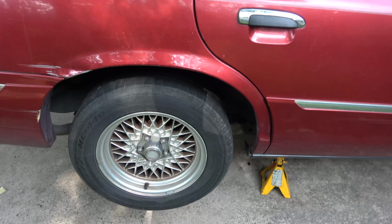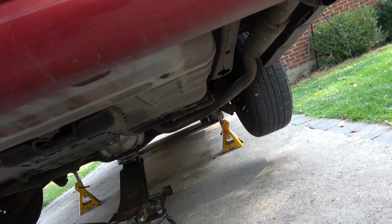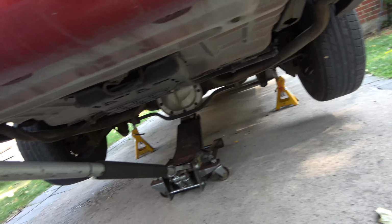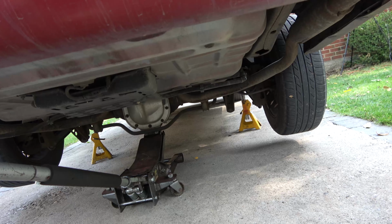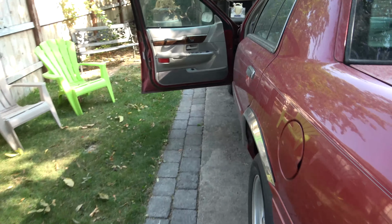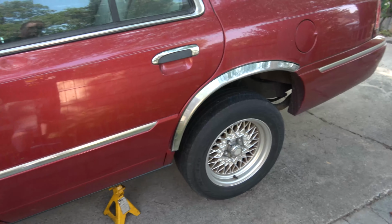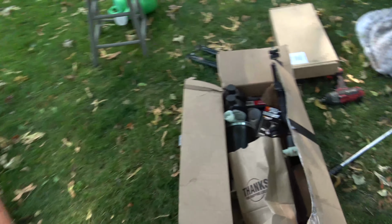Okay, here's what we're looking like. Got the wheels blocked. So we'll slowly let the axle come down. Okay, if we shut the door, the computer should tell the suspension to air down. Yeah, you can barely hear it hissing. She's airing down. Okay, we'll let that do its thing and we'll come back. Hopefully those bags will be fully deflated. And then these will be easy to replace.